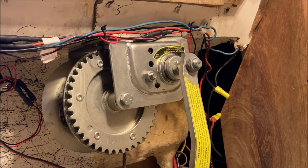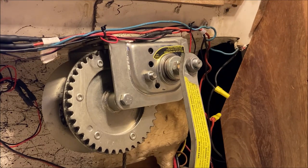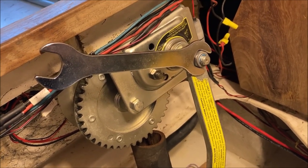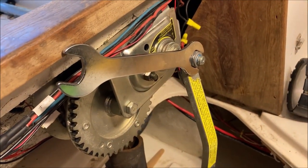So I don't know what it is. I'm going to try the easy fix first. I happen to know the torque spec, so I'm going to take the handle off and re-torque the lock nuts and see if that will fix it. If that does, great — I don't have to take the winch out of the boat. If it doesn't, I have to take the winch out to get to all the parts inside the brake mechanism. Any three-quarter wrench will take the handle off. It's just a nylock nut, but you will need special thin open-end wrenches when it's time to adjust the lock nuts on the inside.